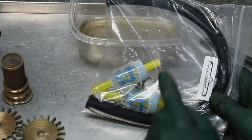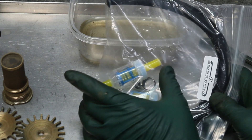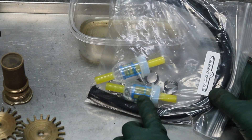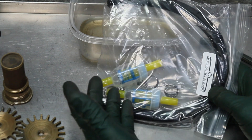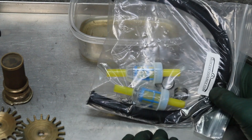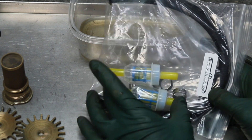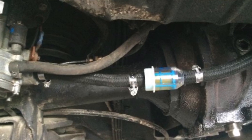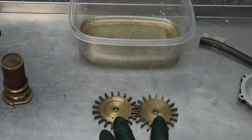The solution I came up with is to put a filter between the tank and the pump. We had to use a special fuel hose to increase the diameter of the filter, but this filter will allow you to see just how much junk is getting by your fuel tank screen — and it will also protect the pump. We include two of these filters in the kit with the correct size hose and clamps. You basically drain your fuel, install the new hose and filter, and you can keep an eye on what's happening inside your fuel tank, which can prevent this type of damage to your fuel pump.